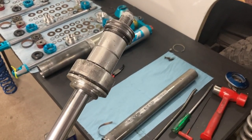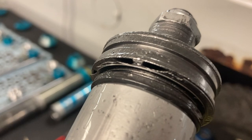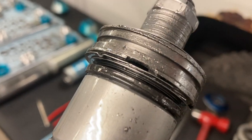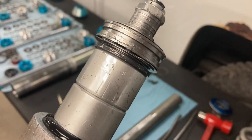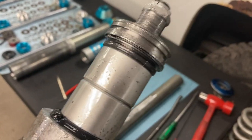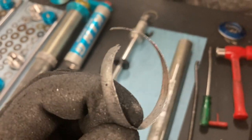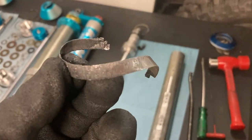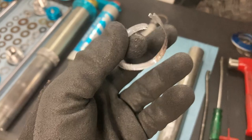I told you the shocks definitely needed a rebuild, but that might have been an understatement. This is what happens if you don't service your shocks when they need to be serviced. I'm missing a few shim pieces right in that area. I'm also missing a whole chunk of the piston - that's gone. The oil coming out was really metallic, silver and shiny. This is the wear band - what's left of it. It's supposed to be a bronze piece with Teflon coating.